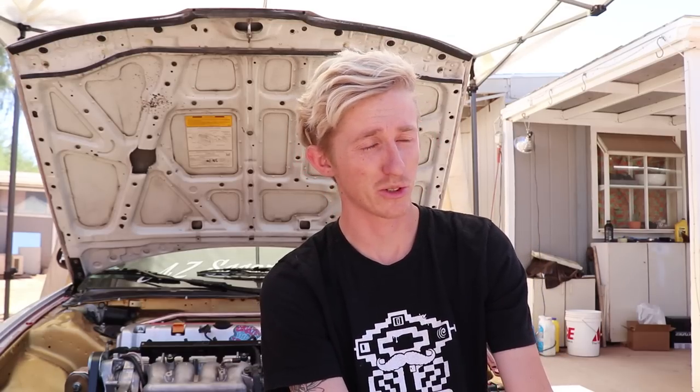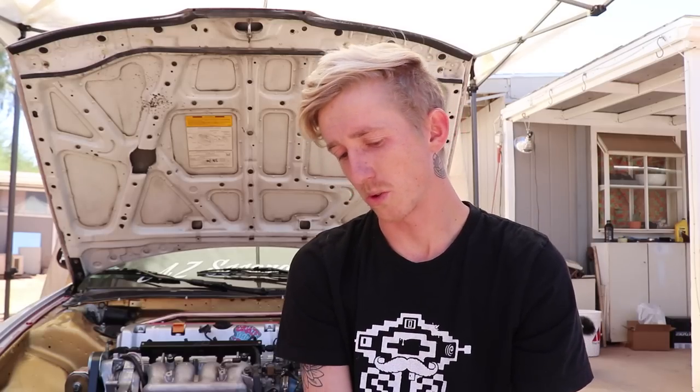Now comes the question of if you should do it or not, and that really depends on your situation. Personally, I would not recommend using a brake booster delete on a daily driver because if you commute on the freeway and somebody slams on their brakes, your response time is going to be delayed because of that more firm feel. Whereas normally you'd switch from gas to brake really quick and ABS helps you out, with the booster delete it's going to be a lot harder to handle that emergency braking situation, and there's a chance you could end up hitting somebody. You don't want to blame it on the booster delete.